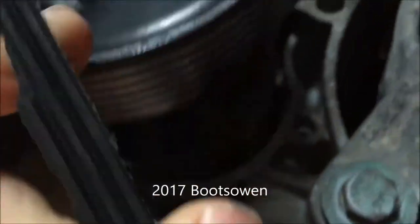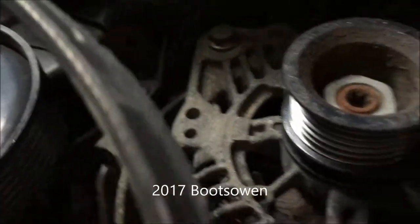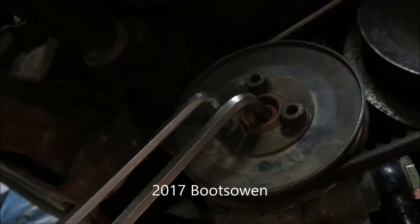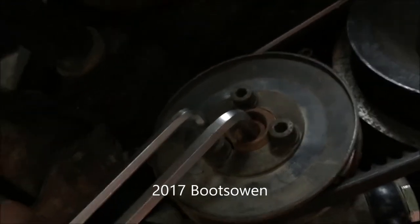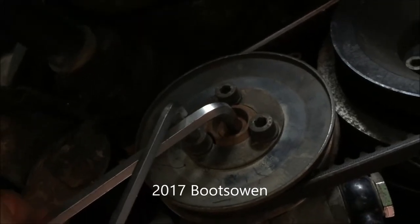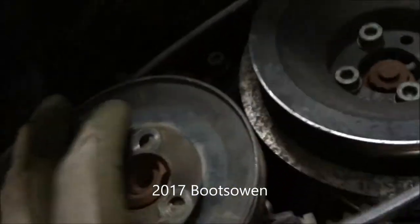The belt, in fairness to it, was holding up on 2 ribs by the looks of it — it's a wonder. I've broken all of the seals on the bolts by putting a big allen key into the centre and then levering the small one against the big one to loosen it, so it can come across. But the big one holds the pulley from spinning. And once you have them out you'll notice there's a couple of shims here, and there's no tensioner on this pulley system.